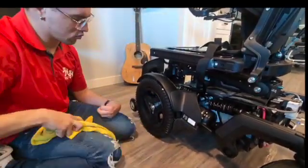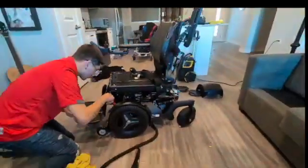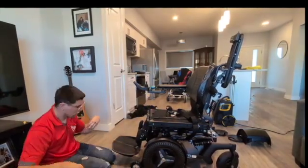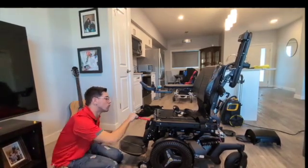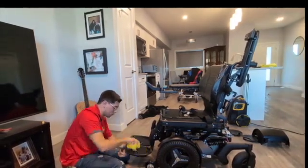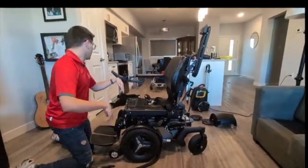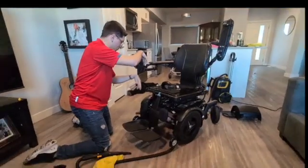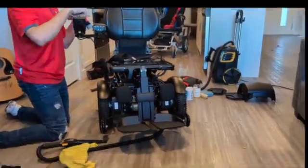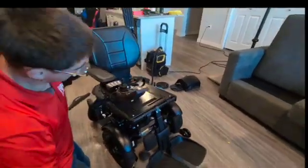Not all ceramic coatings are professional grade like ours from Homer's Place, so you can definitely do it on your own. I would just highly suggest you take your time, do it properly, and don't rush the process. If you are doing it on a car or any type of painted surface, you're going to want to get the paint as perfect as you can. That entails clay barring the vehicle, wet sanding any major scratches or defects, then compounding and polishing the paint to near perfection, so that the vehicle and the ceramic coating look as good as possible.